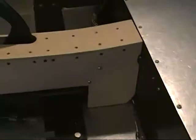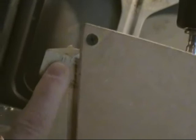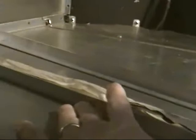What I'm doing is building the forward part of the console. I've got this block of wood here — I've given myself about an eighth-inch gap all the way around here, so I built this little keystone piece to fit up in here. Now that that's all hooked on to this other piece, these two pieces will come together — this will be the front part of the console and this will be the back part. I've cut some little aluminum angle pieces and figured out where they're going to go on the floorboard on both sides. So I'm getting ready to take this whole floorboard out and silicone and rivet these pieces in place for the front part of the console.